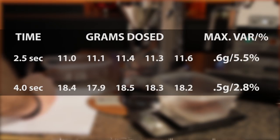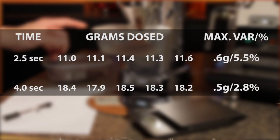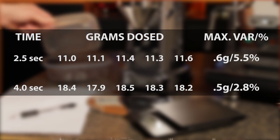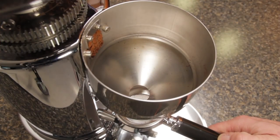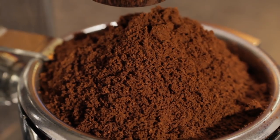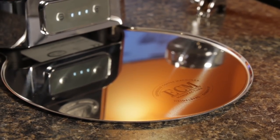To check accuracy cycle to cycle, I ground five times at two and a half seconds and five times at four seconds and weighed the results. The two and a half second cycle averaged a little over 11 grams with a maximum variation of 5.5%. The average for the four second cycle was a hair over 18 grams with a maximum dose variation of less than 3%. In my experience, the Titan matches or is slightly better in dose accuracy than other grinders in this price range like the Eureka Mignon E-37S. A funnel feeds ground coffee to the portafilter — grinds come out fluffy and distribute evenly, which helps prevent channeling when brewing. There's very little spill beyond the portafilter, and any coffee that gets by lands in a large stainless steel tray for easy cleanup.